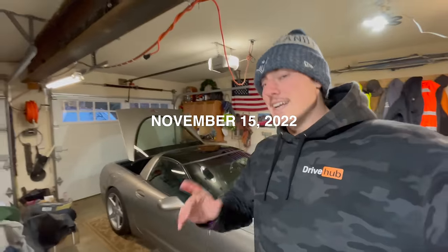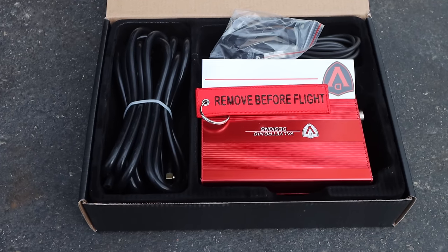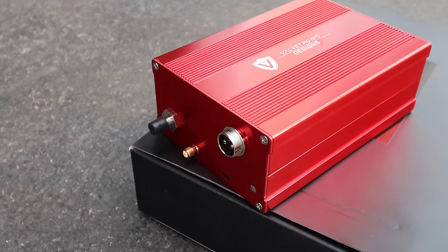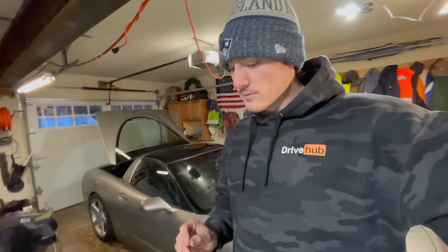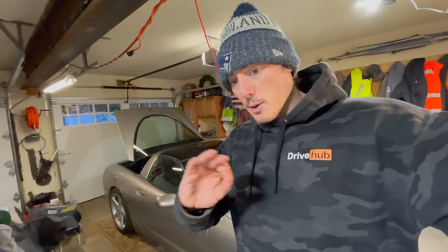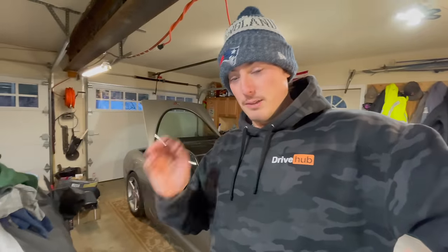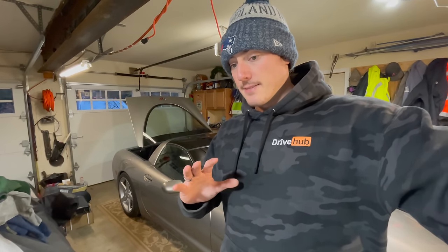So here's how this whole thing is gonna pan out. The mufflers are controlled by a vacuum box. They're vacuum actuated. You need power to that vacuum box. So they give you a cigarette lighter power adapter. You then run that to the vacuum box. The vacuum box then has one vacuum line that has to go from the interior of the car, obviously, to the exterior. You then, don't laugh, Jake, don't laugh. You then take the T-split and put the hoses to each nipple. You put the vacuum lines to the nipples that are on the mufflers. I am 25 years old, this is bad. Those lines go to the mufflers and that's basically it.